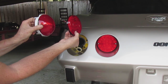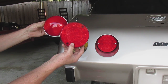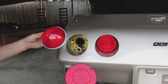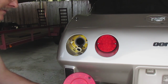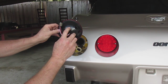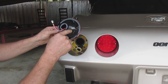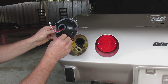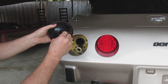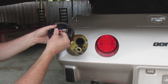You can see they're flat — that's what I like about them. What I thought was really cheesy about the old ones was that white trim backing plate. It's plastic, and when I screwed in the actual lens it pulled the inserts out of the plastic, didn't seal very well, and one of them actually filled up with water after I washed the car one day. So I really didn't have much interest in those anymore. As for the new ones, they install like this — if you turn this around, that's how they fit. It's got a connector that connects into your bulb socket, it's got a printed circuit board inside that's conformal coated to keep moisture out. You connect this into your socket, put the wire down inside, and screw your socket into the housing — basically just like a lens on the original lights.